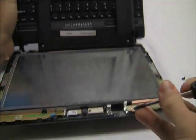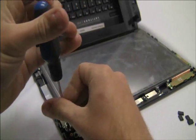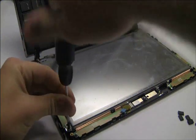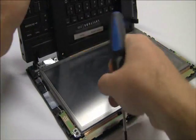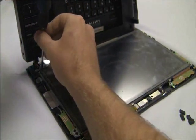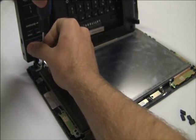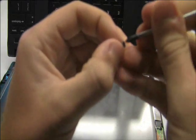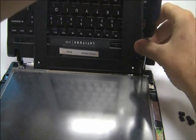Before this point, if you want, you can plug the laptop into a charger and boot it up. If the screen comes on, you're good to go — put it back together. If not, check the cable again and see if you can reseat it. And if nothing works, then the laptop sucks — cause they already do.